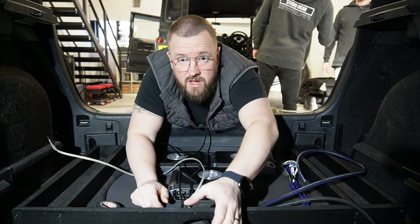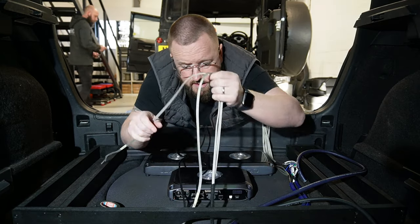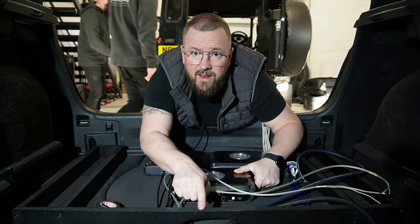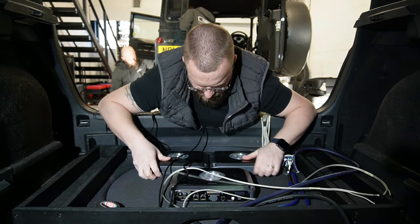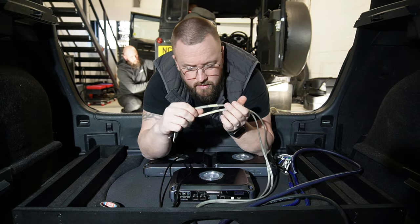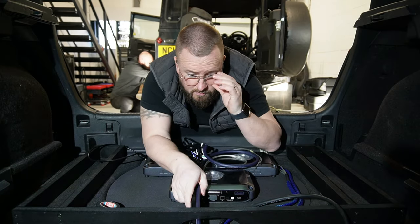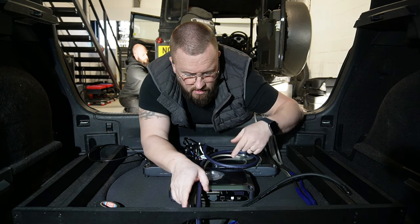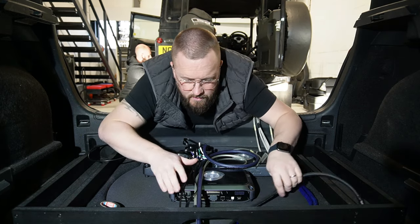The majority of these cables are just going to land straight in the front of this VX606 right here, so they can be relatively short — these lengths will be removed because it's pretty much straight there. They pass under this bar here and straight into the amplifier, so I can actually cut these right down. I won't do it right now — we mark it all up and know what everything is around the car first. All of these cables basically run straight forward, and then we've only got power and a speaker cable that has to run around the amplifiers in various positions, so those may need splitting down a fair bit.